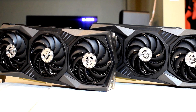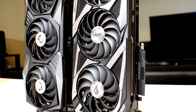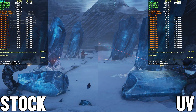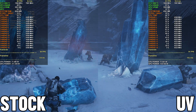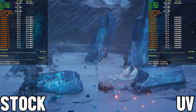We were able to significantly reduce power consumption during a heavy GPU synthetic load, lower temps, lower noise, all without barely sacrificing any performance. Also, the power usage during actual games was even lower considering that a heavy graphics test will put 100% of the load on the GPU whereas in games there are fluctuations in GPU usage, which means lower power consumption.